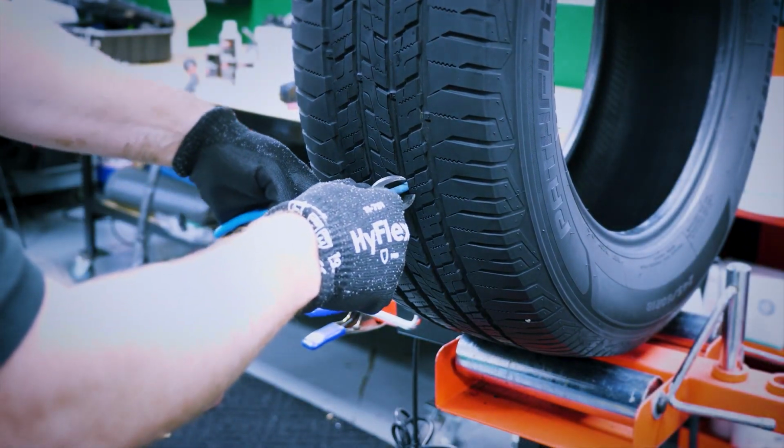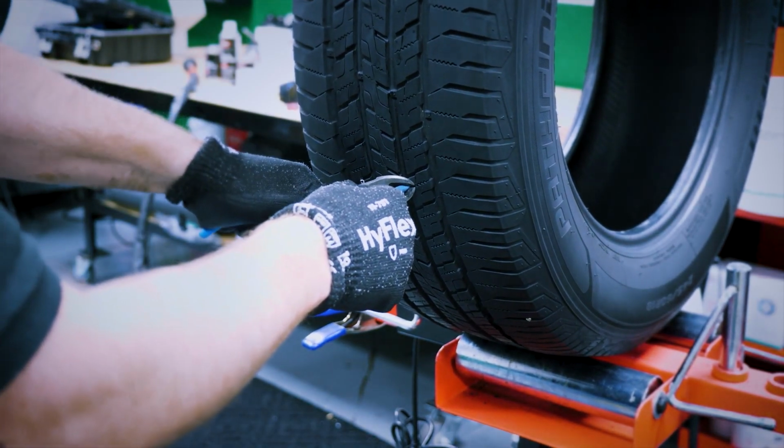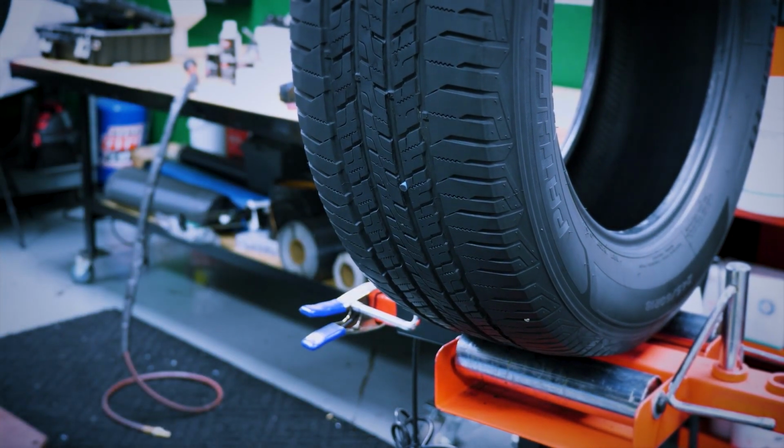Cut the excess stem off so that it's flush with the tread. Do not pull the stem while cutting it off. Then you are finished and have completed a full process of repairing your tire with a one-piece repair unit. Follow the steps carefully to ensure a safe and secure ride.